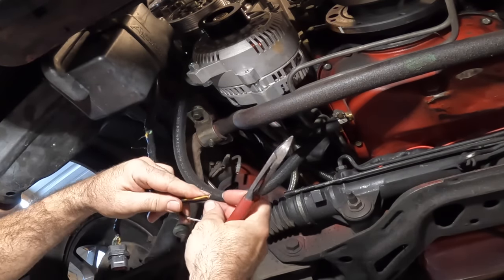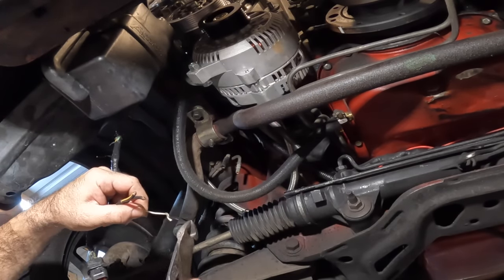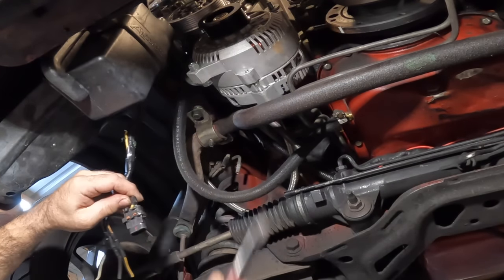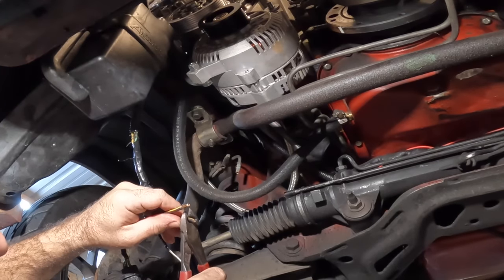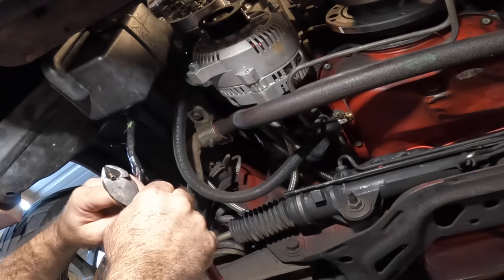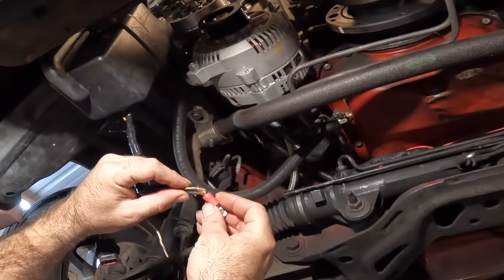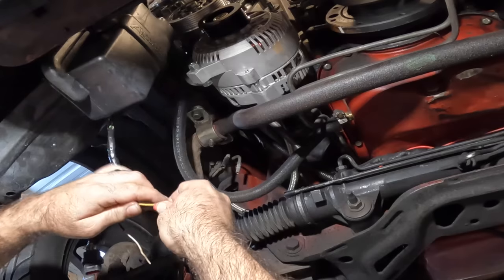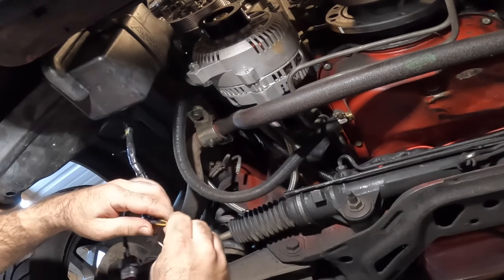So what I'm gonna do is tie these two wires together to one single lug, and then put a spade connector on here, to where it'll plug into the back of our stator, all right? That's it. This plug stays the same and it'll go up into the alternator. Okay, so those two wires right there together, and we're gonna put a single connector on this. Push both wires through together.